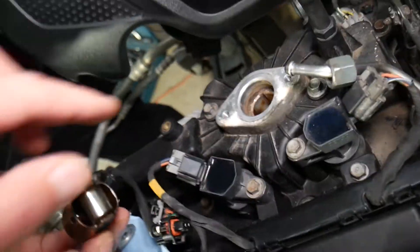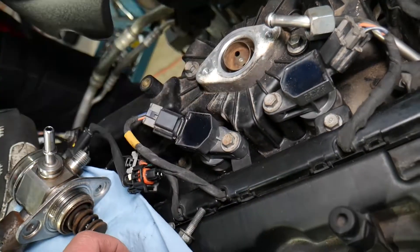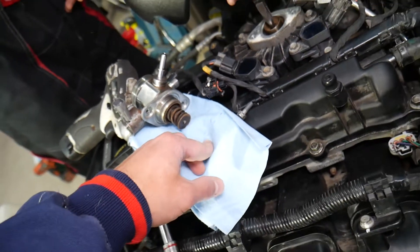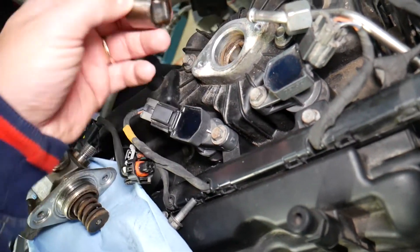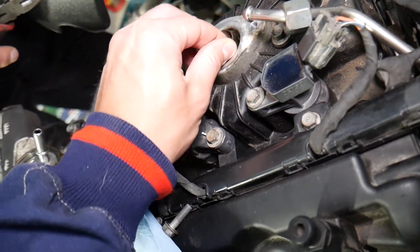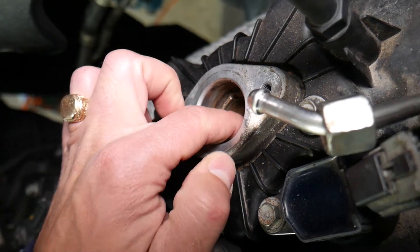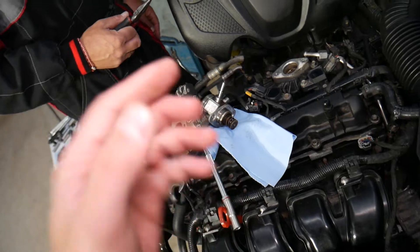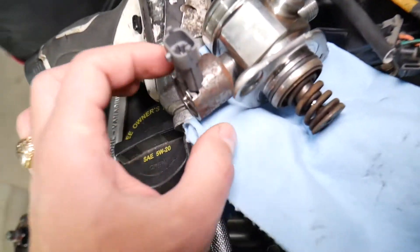You have the cam follower here, and I recommend that when you replace that pump, always replace the cam follower as well. We have a special video that explains the proper way to disconnect and remove the fuel pump — the cam follower goes in only one way, so be careful not to get it sideways. If you do the removal wrong, you can catch yourself on fire, so check out that video on how to replace the high-pressure fuel pump.